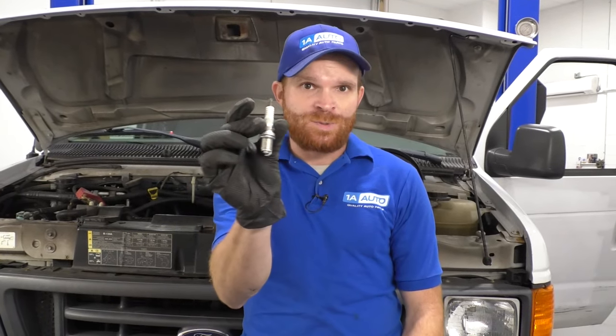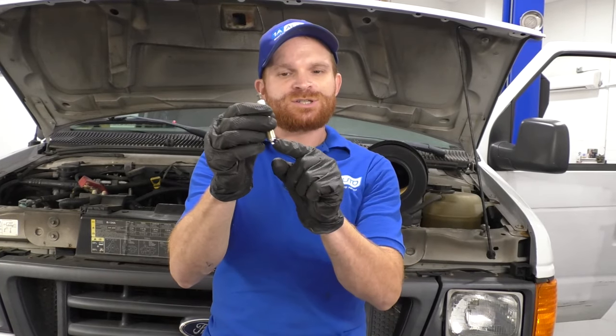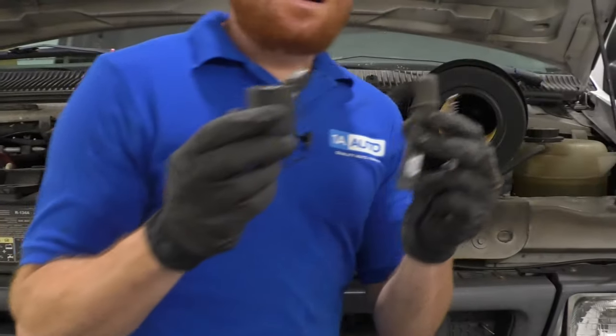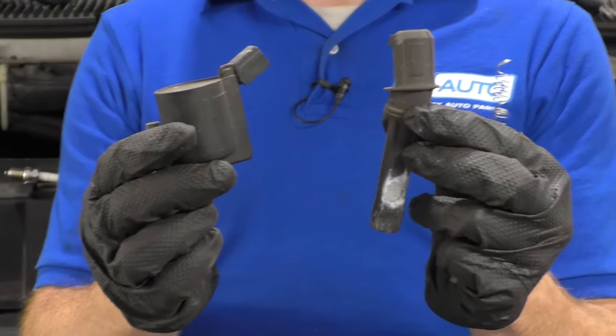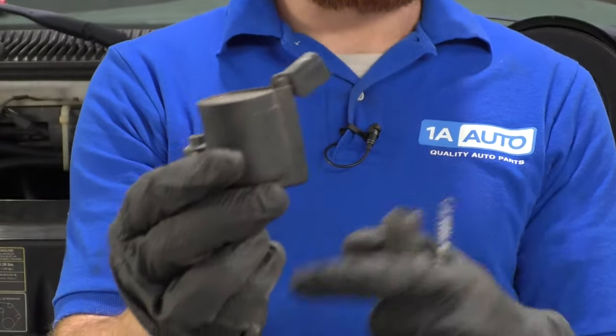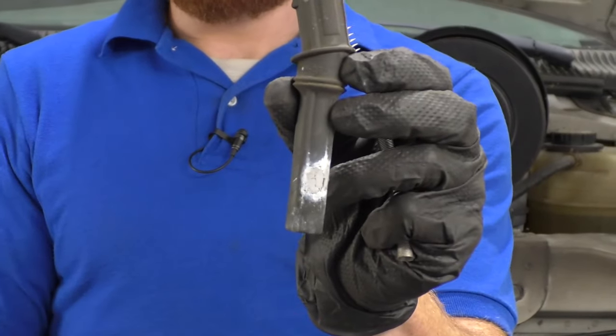On these particular vehicles, the maintenance isn't due for the spark plugs until 100,000 miles — that's a lot of miles before they're due, and a lot of things can break down over that time. Not just the spark plug itself, which can break down especially down by the electrode area, but you might also notice a heat crack in the spark plug porcelain up along the top. The most common culprit though would be the coil packs. The coil itself can break down over time and become an issue, though it's less likely than an issue with the boot.